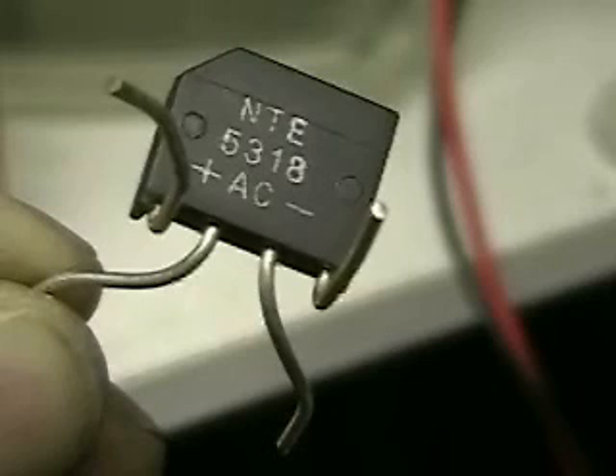The series two system will incorporate a heater, or we're going to keep the plates on during the night drawing 0.09 amps, and that will hopefully keep the water warm enough so that it will not freeze. The ultimate would be to have a thermostat so we could keep it cycling on and off. Right now what I'm going to do is test the series two unit overnight outside the car to see if this will fix the problem.